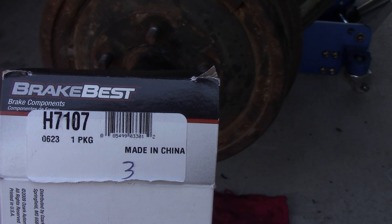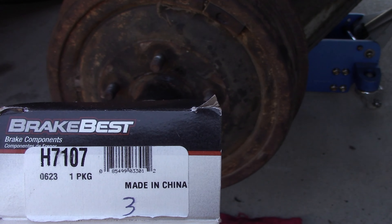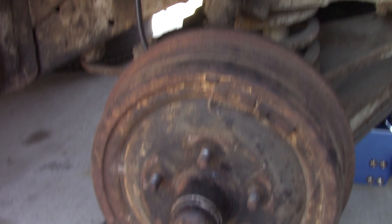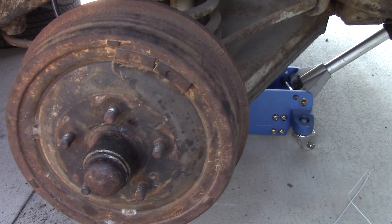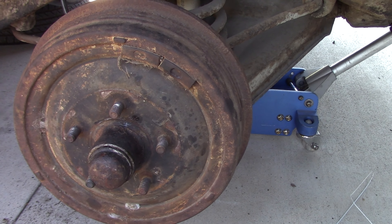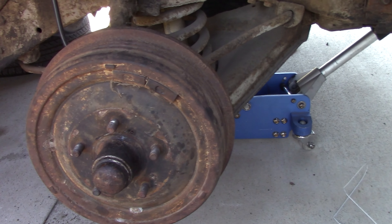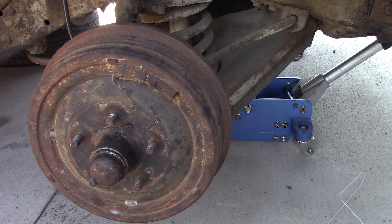This kit looks designed more for the rear brakes on those cars because it has extra pieces for the parking brake lever, which you don't need on the front. Anyway, we got all new brakes — the only thing we reused was the drums. New hoses, new wheel cylinders, spring hardware, shoes, and we repacked the bearings. Both inner bearings had a little bit of corrosion from sitting. One roller was etched — one bad roller means the whole bearing is bad — so we put new inner bearings in and repacked the outers. Front brake-wise, we should be good to go.